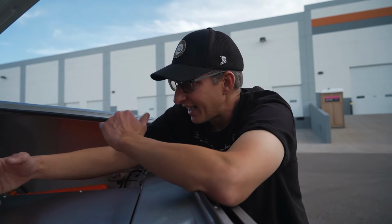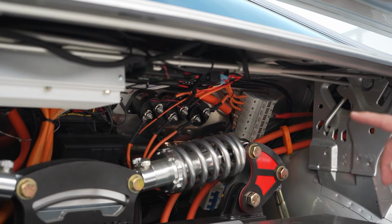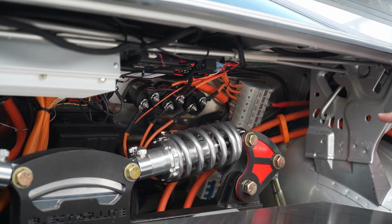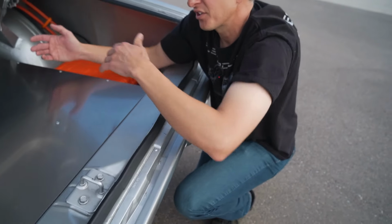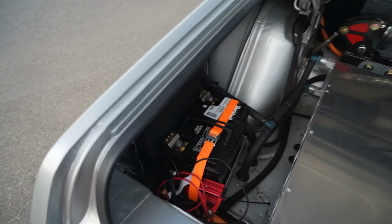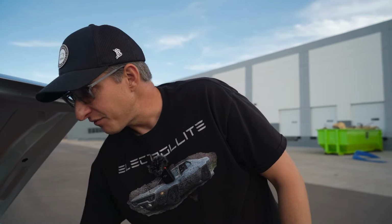This other wiring, there's some relays, these main contactors here. I've got a heater, like a heater core. Okay. I've got a battery heater, I've got the air conditioner, charging, and also a DC-DC converter, because I still have a 12 volt battery. Oh my God, you do. That's crazy, you have to charge that. So you actually pull 400 volts, step it down to 14, and it's like having an alternator.